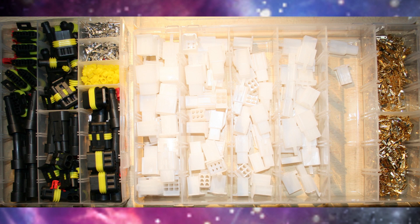Before we start, the Lexmoto has really cheap wiring and connectors. They are very prone to faults due to water ingress, going green with oxidization very quickly, causing reliability problems due to electrical resistance issues. It's worth investing in new wire connectors and be sure to take the time to solder on the terminals.